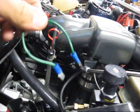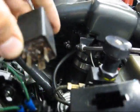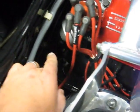And you want to jump your fuel pump. This is the fuel pump relay. Once you have the fuel pump relay located, you want to jump the pump. It's most recommended that you use a fused wire. You bypass the two plugs that are closest to the small plug. Then you turn your ignition on. If you happen to have a wideband, before you turn your ignition on, you want to disconnect your sensor — it's not good for the sensor to run with the ignition on for a period of time with the motor not running. So disconnect your wideband.